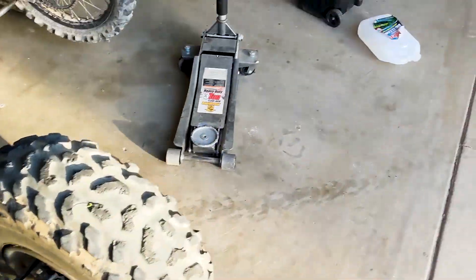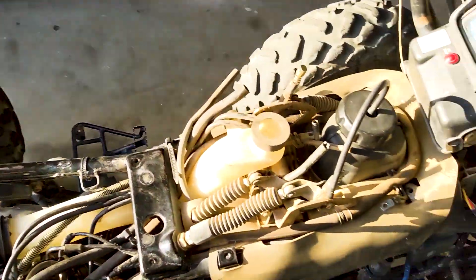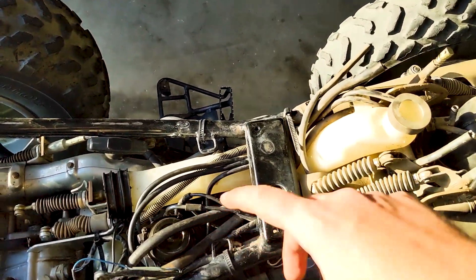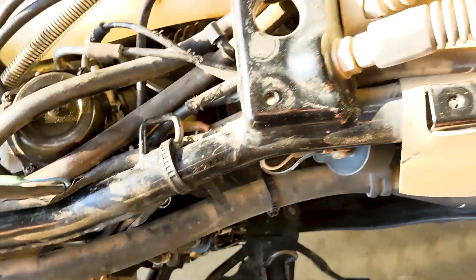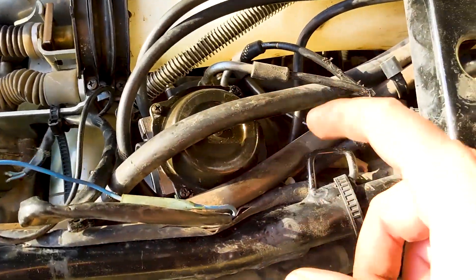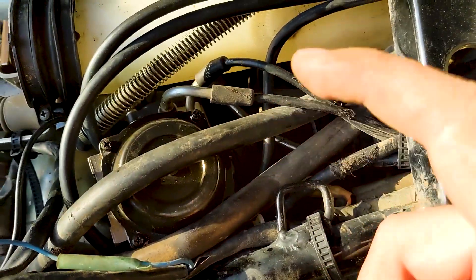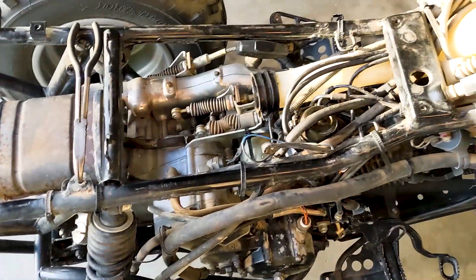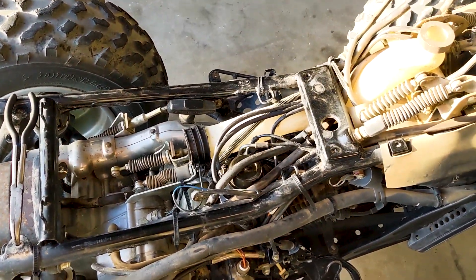The carburetor rebuild was a success. A lot of this stuff can be kind of fiddly — you usually have to take this apart to get the throttle cable off of the carburetor. This has a fuel pump on it which has a vacuum line, so you can't drain the fuel; you just get it to fit in there. I usually like to lube everything up a little bit — like the little rubber bushings — with some WD-40 or something to make it slide in a little easier. Now it's warmed up just fine, and when you give it throttle it doesn't bog anymore.